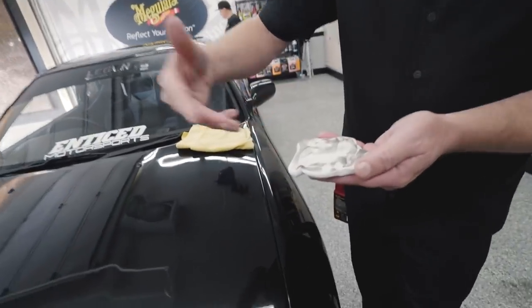That's insane. And besides the feel-good factor that it's smooth, because everybody loves that, it actually plays an important role, because with all that almost barrier coat in there, of paint or overspray, your polishes, your waxes, all that other stuff doesn't work as good because you're kind of fighting to get through all this stuff that's on top of the paint. So you can't really massage or protect or condition the paint good until you get that, we call them bonded contaminants that are just stuck.